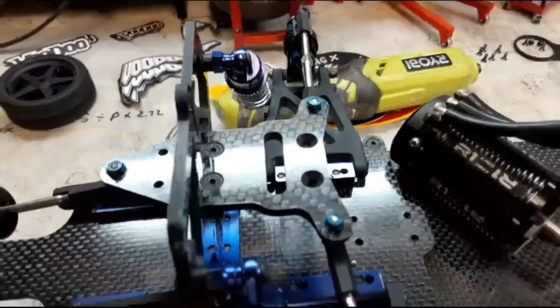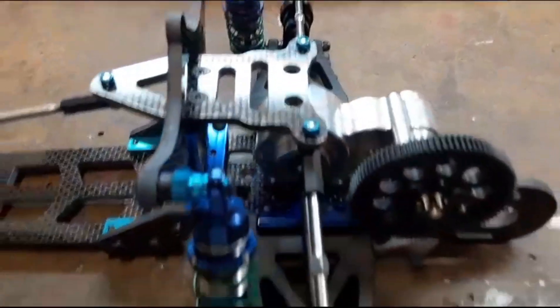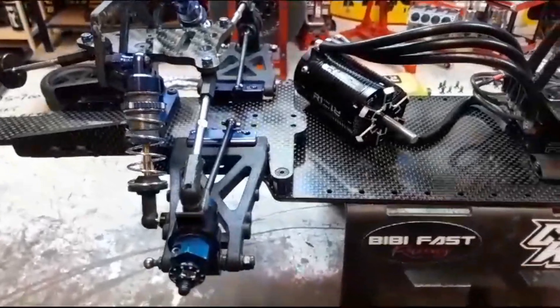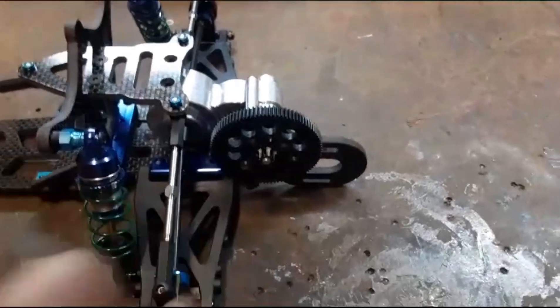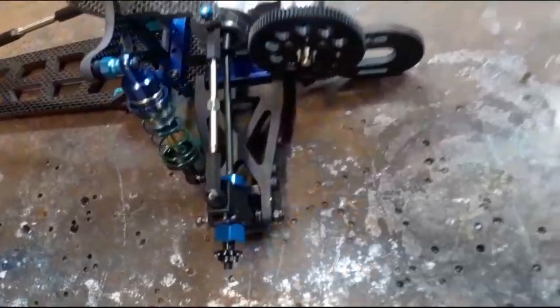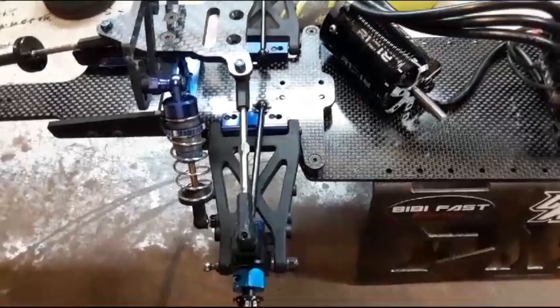The shock tower is completely redesigned — this is the V1 wheel version — and it's thicker. I also notice the geometry is different. The shock is vertical with the same setup, leaning to the back a little bit. What they did was move the toe blocks back and move the tranny forward. You can see the links are straight with the axles underneath them, and the tranny's moved forward because the links are leaning towards the back.